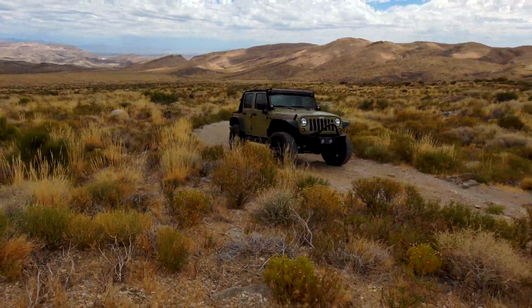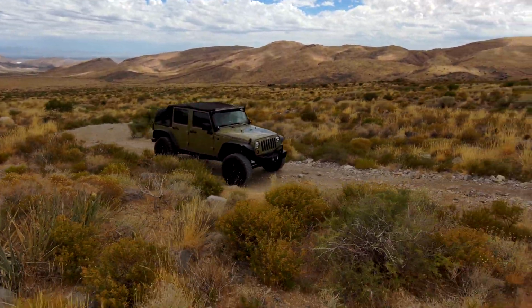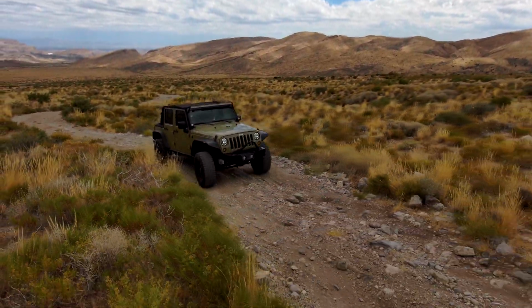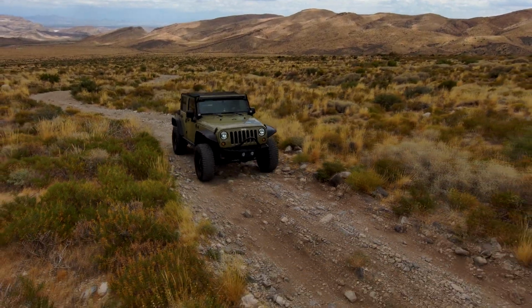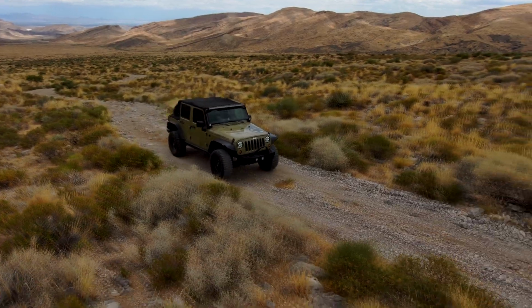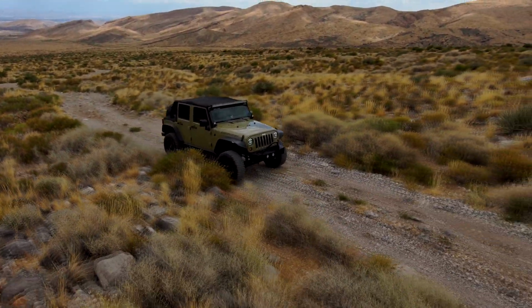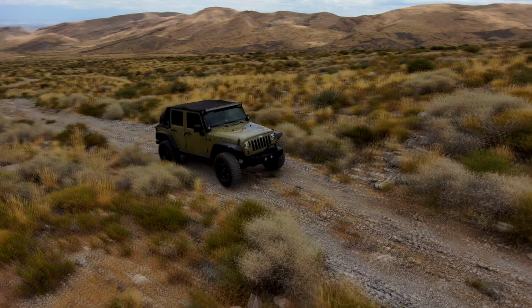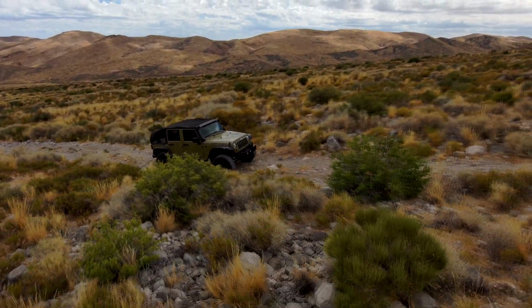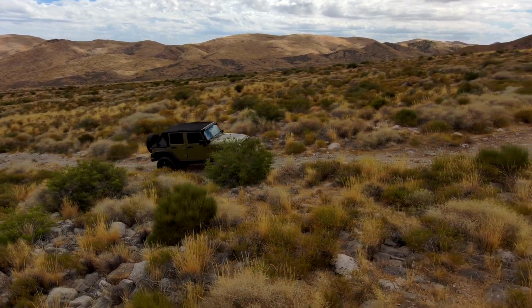So the aluminum dissipates heat really good, and the new quad header radiator, in my opinion, is top of the line. We're seeing them go year after year with very few failures. So if you have the quad header radiator, you got the rail cooler, you add the transmission cooler, the grill is completely unobstructed, your wheel wells are not obstructed, holding the hot air in, then that's going to do it for most JKs, even out here in the Southwest.